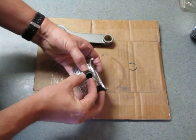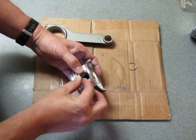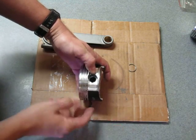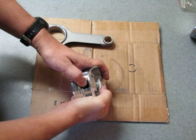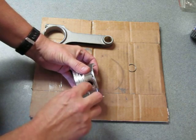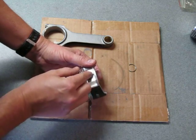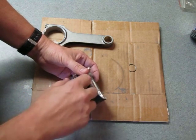Let's try this one. Now I've got it resting against that pin in there. I'm just going to force that backside down — and you can hear it snap in. And now it's in there. Actually that one went a little deep, so force it back with the piston pin. There we go. The retaining lock is in the groove. You can tap it a couple of times if you want, or take a screwdriver and grab the end of it and push on it a little bit. I got this one slightly off center, but I can always move it over with a screwdriver later.